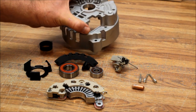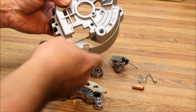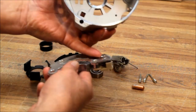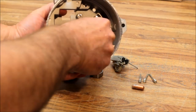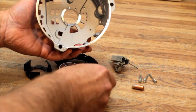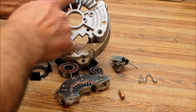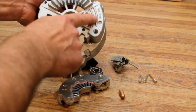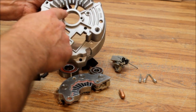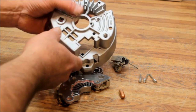This is an upgrade — I had this housing patented; I was a co-patenter on this housing many years ago. The problem is GM has a heat sink type bridge rectifier. This rectifier goes inside the housing, and as it converts AC current to DC current, it dumps heat using heat transfer compound into the housing. That heat has to be dissipated away, and without fins on the back they had a lot of trouble with it. The rectifier would overheat and also dump heat into the rear bearing, causing the bearing to fail.